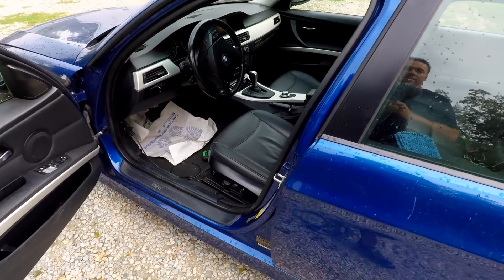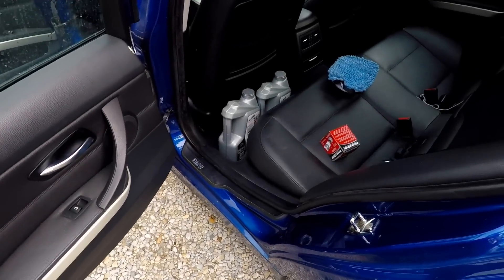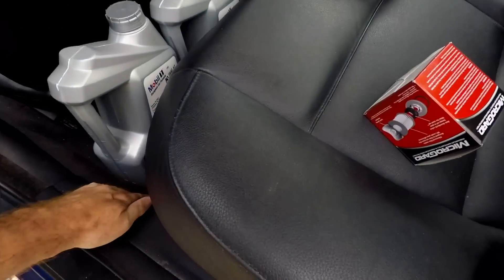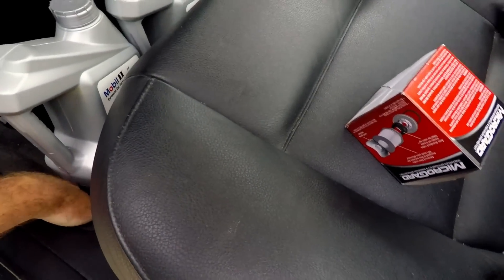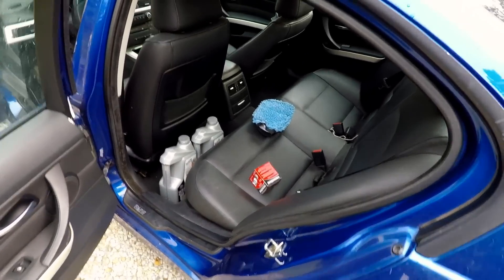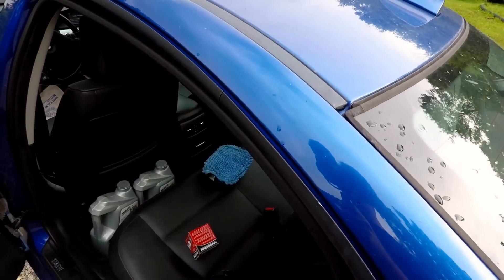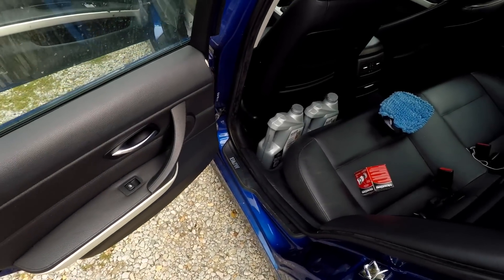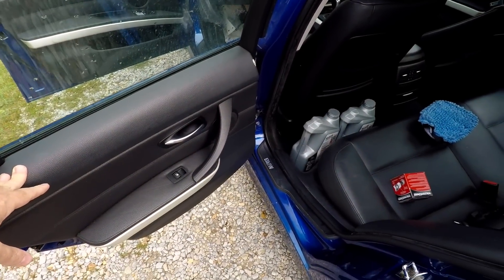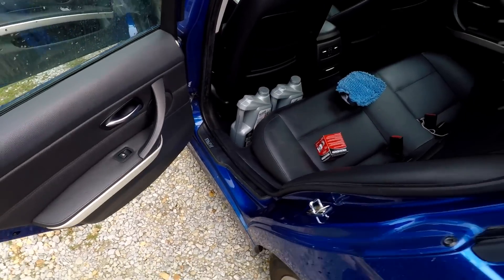The biggest thing inside — check the carpet. Just feel the carpet. Does it feel wet, either in the back or the front? That could be a sunroof drain problem. These do have that problem. Somebody could have had the door panel off and not put the door insulating foam back on correctly. There are many things that could cause it.